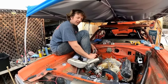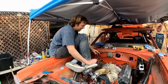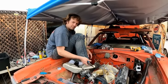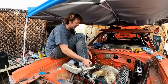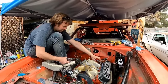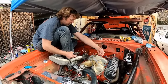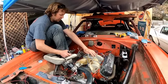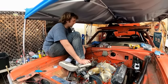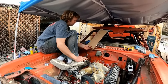Well, radiator hose situation solved. Now I just gotta take care of the wiring. Luckily, there's only like four wires, so I just need to route those couple of wires, and Derek got the plugs in. Then we'll put oil in it, prime it, put the correct distributor in it, plug wires. Oh, then I gotta lengthen the throttle linkage. The bracket. I gotta raise this up about an inch and a quarter, so that way it'll work with the carburetor, because this manifold is like an inch and a half taller than a stock manifold. The list is kind of getting some things knocked off of it.